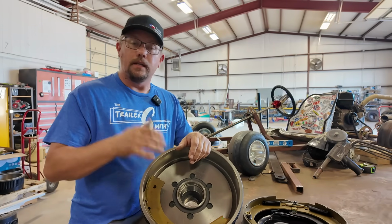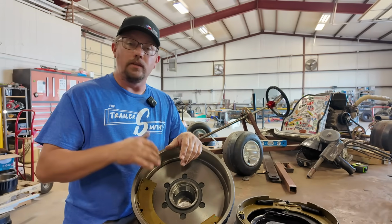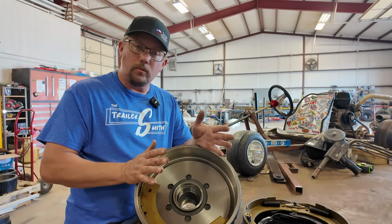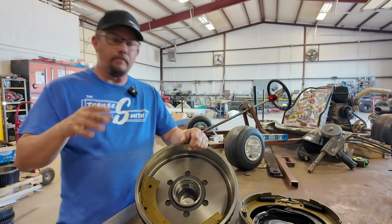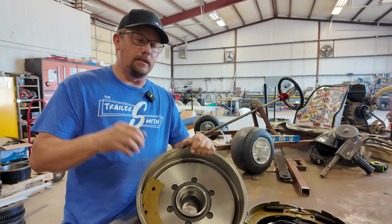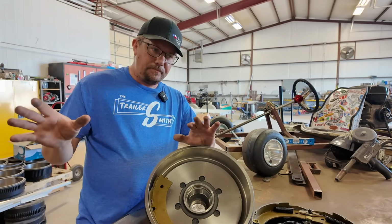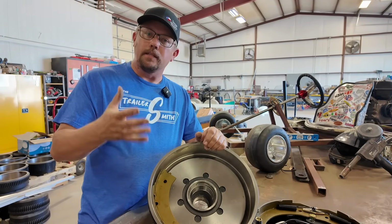What you will do is get these so hot you will boil the grease out of them and potentially cause a fire, and then you'll have zero brakes and maybe even burn your recently serviced travel trailer to the ground. We don't want to start the summer off that way. You need to educate yourself on the brake system. You need to know when to adjust it, how to adjust it, and how to operate that brake controller, and we have videos on most all those subjects that go in depth per component, per operation. We'll leave a link in the description below, but it's your responsibility to know how to do that.